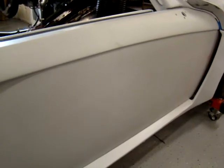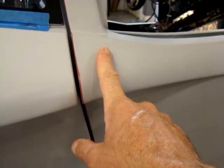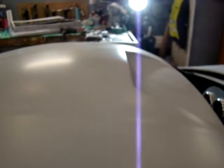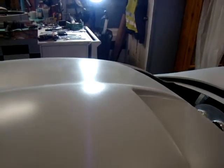You can see the Slick Sand sanded down, and then as I transition right here, this is actually epoxy primer, and there's Slick Sand under it, and then this is Slick Sand. I haven't primed the doors yet because I'm doing the final fitting on the door. So anyway, you'll have all those different colors, and especially on the roof scoop, you'll get to that point. Those different colors will drive you crazy. So again, the Slick Sand helps to visualize where the imperfections are on your paint, as you can see with the lights shining in different areas.